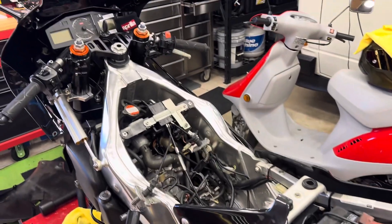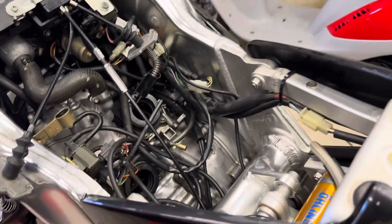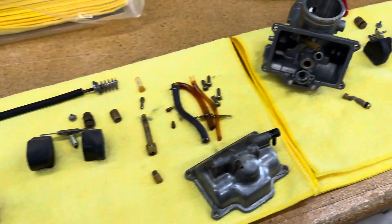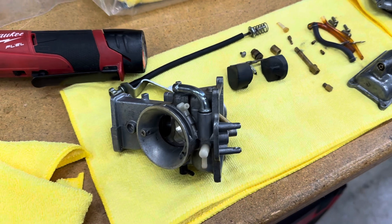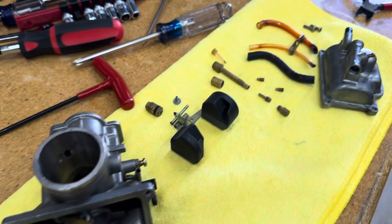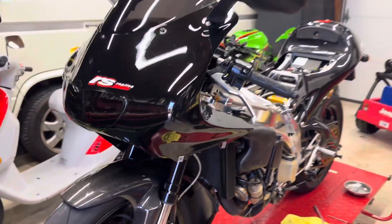I'm pretty much an expert on this and I do it in the laziest way possible. I leave the slides and throttle cables hooked up, yank the carbs out, and I do take the opportunity to do a bit of cleaning. But most importantly, you've got to totally disassemble the carbs — I don't care what anybody says. They do not get clean unless you take them all apart. You aren't just spraying some carb cleaner through them and slapping them back in. These are going to go in the ultrasonic cleaner and then this bad boy will be ready to rock again.